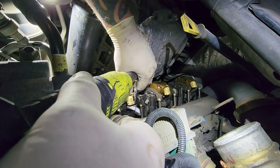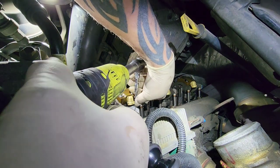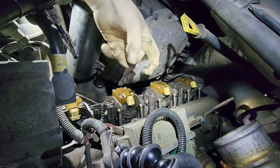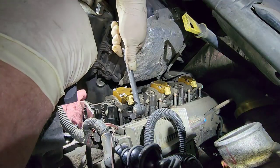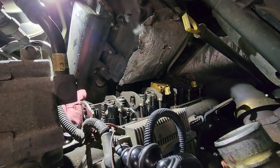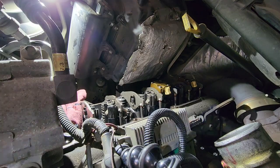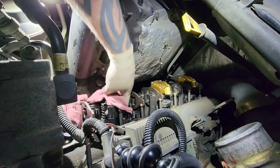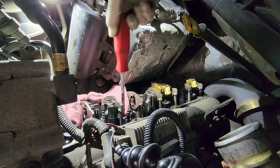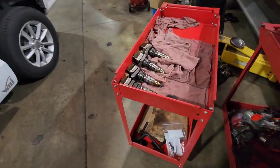There are only two bolts to take out to remove these injectors. The first one is the oil deflector — it's going to be an Allen bolt — you're going to take the bolt and the oil deflector out. Then there's also the bolt below the injector that holds the hold-down. Now just use an adjustable pry bar and pop these injectors — they pop out really easy. Once you pull the injector out, have a rag handy and a screwdriver, and shove the rag down in the hole to sop up as much oil, fuel, and coolant as possible so you don't lock up the motor.